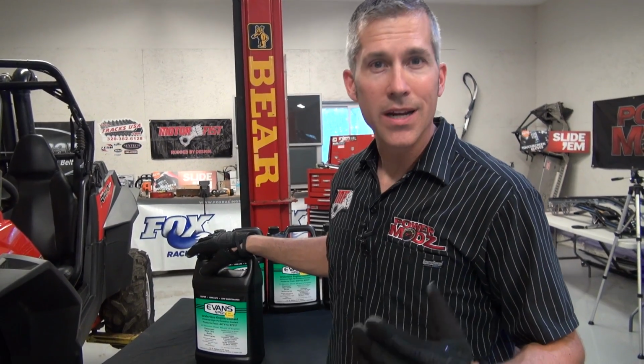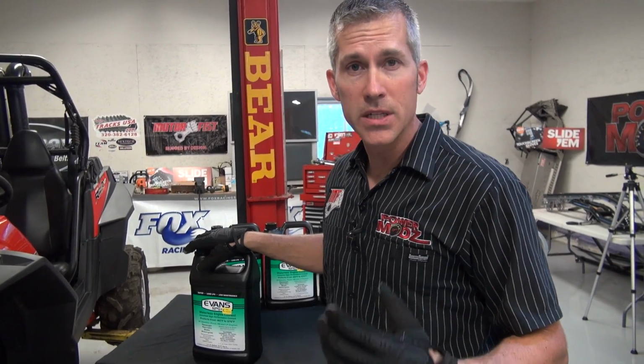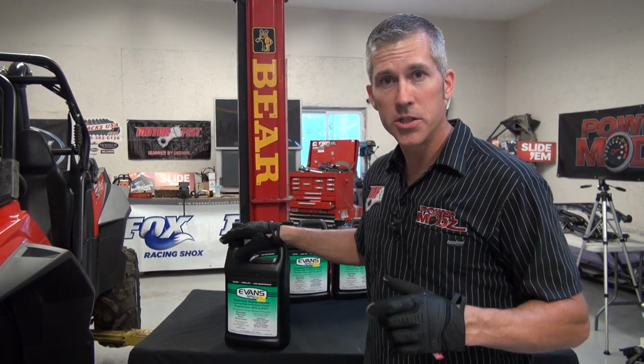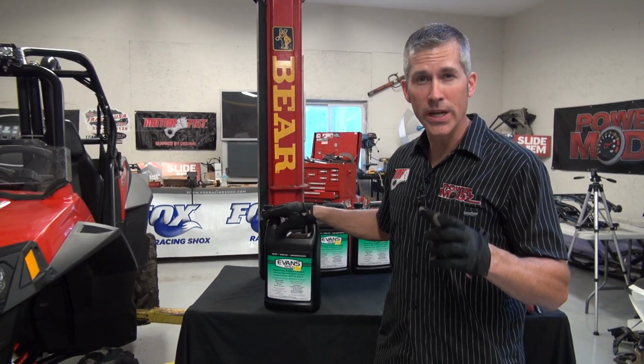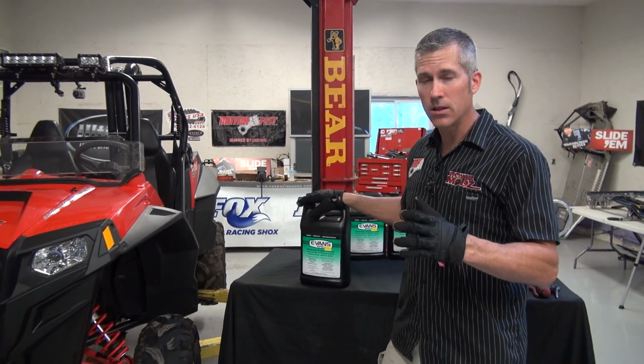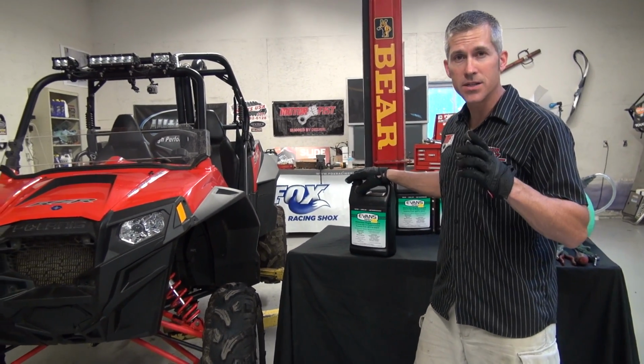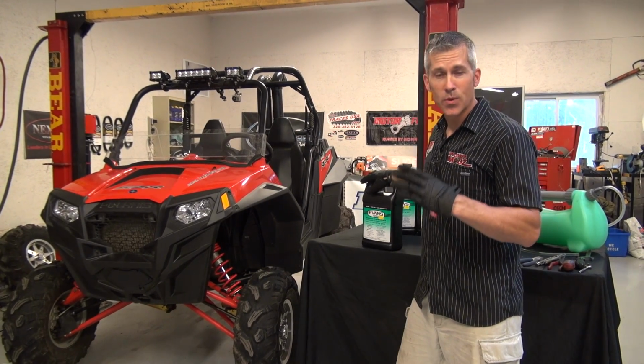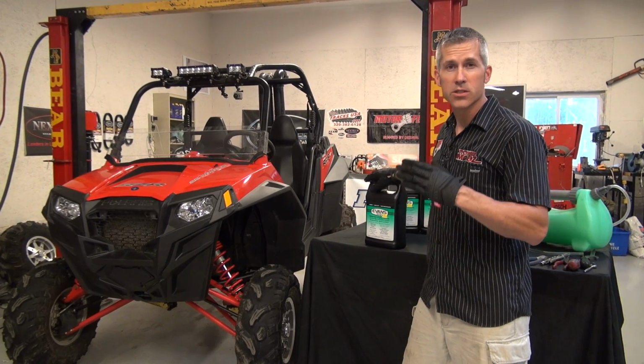Now for you guys running in really dusty and dirty environments, in the sand, in the mud, running through the swamps, one of the biggest issues we have is mud and dirt and weeds in our radiator. Now, it doesn't take long for that thing to clog up, and that starts to affect your heating and your cooling system. And at some point, it actually just cuts the radiator right out of your system. Your machine is going to overheat.